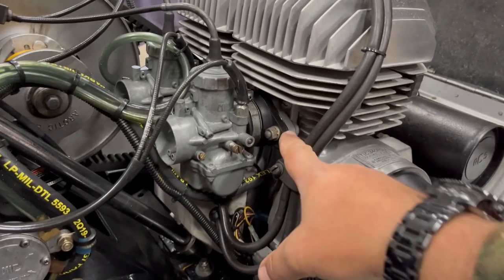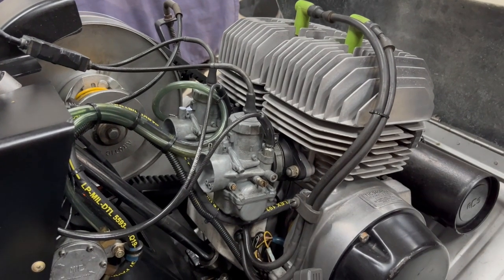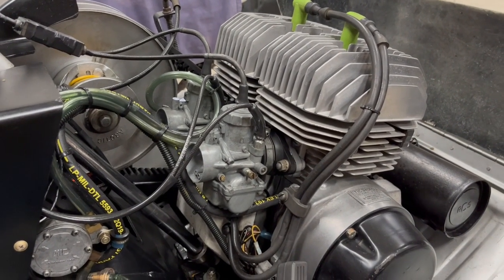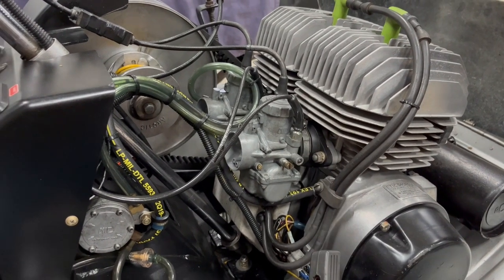I know exactly what it's going to do, and it does the same thing every time. You can see these adapters in here that go right to the cylinders. This is a Kawasaki 340 Free Air. I'm doing a Kawasaki 340 Fan, so we're going to have some obstacles which we'll work through. But dual VM-34s — this new project will be jetted identically to these.